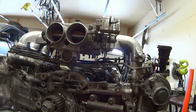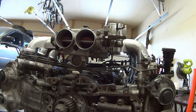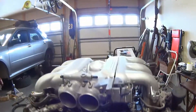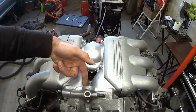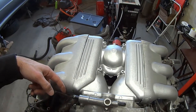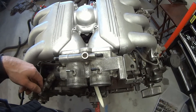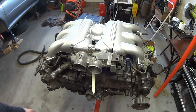Some people could do e-throttle, or you could change the throttle body out completely, but I don't want to do that — I want to make this as simple as possible and just run the stock intake. Another idea I had was flipping the intake upside down a little bit. There's this piece here you could cut off, but then you run into a worse problem on this side with the throttle cable setup. That could be an option, but I'm not ruling it out yet.